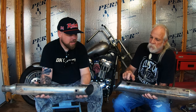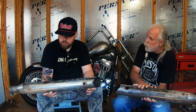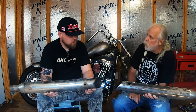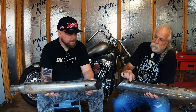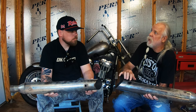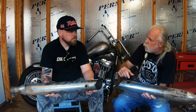There are a few reasons this can happen. This is a good muffler — a Rush muffler purchased new in 2005. If you didn't use a washer, or if you used just the lock washer when tightening it down, it digs in and weakens the metal. So you want to use a washer on both sides.